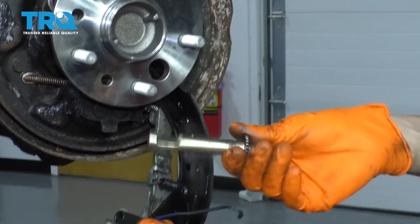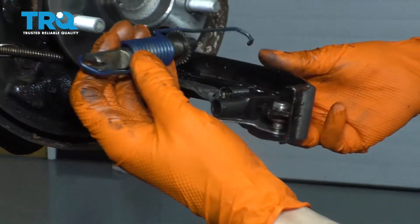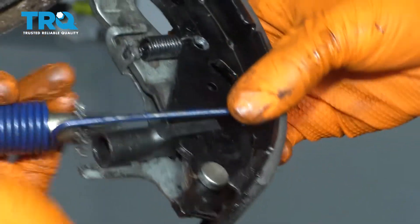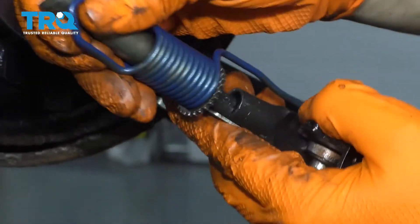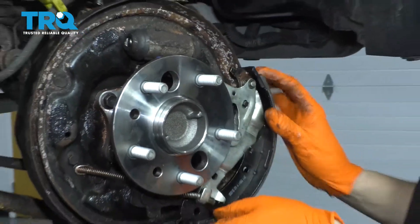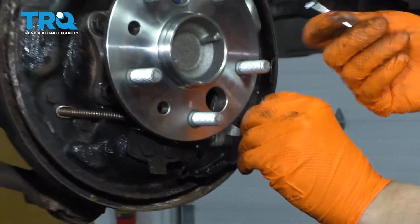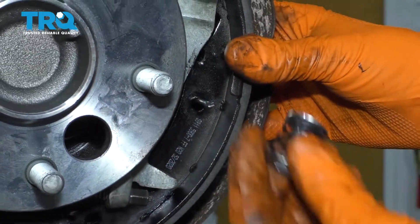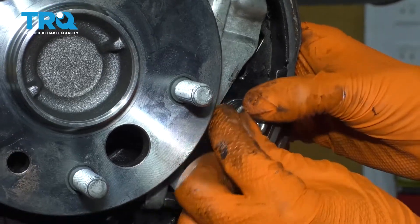Before we reattach this spring, I want to take my freshly prepped lubed adjuster and put it on with the longer area towards the shorter part of the spring. The longer part of the hook of the spring should attach into the rounded hole over there. You kind of have to angle it at a weird angle and then just press it down — make sure it's attached. Take your adjuster and slide it into this other piece. Now take the shoe, slide it up and over, making sure it's hooked onto the top of the brake cylinder as well as on the bottom retainer. Then take your pin, find the hole through the backing plate, and slide it all the way through. Take your spring with two caps — one on each end — line up the slot for the caps, press it on, and twist it 90 degrees to lock it.